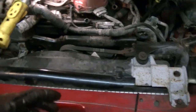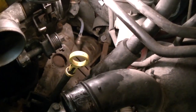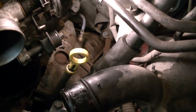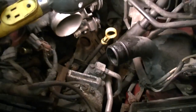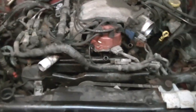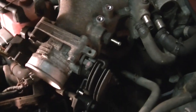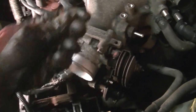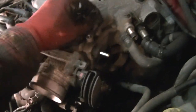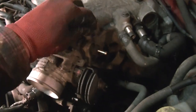The goal is to get down to the head so we can take it off. I'm going to pull the head off with the manifold because there's no way I'll get all those manifold bolts out — I think it'll just be easier, and I can replace them later. On top of the plenum, go ahead and take out the two bolts for the throttle cable bracket — that's a lot easier. Move it out of the way.